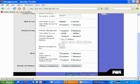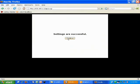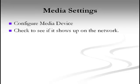After this, click save settings and it'll save. It'll then ask you for our username and password. The username is the SSID and our password is the new password that we just changed it to. It's also a good idea to use the backup button in that same window to backup all of our settings that we've already done, so that way we don't have to do it again if something happens.